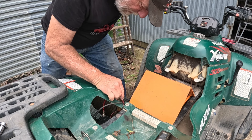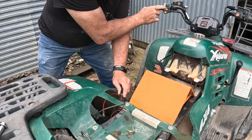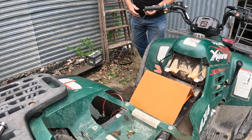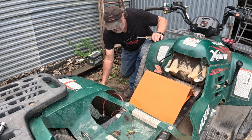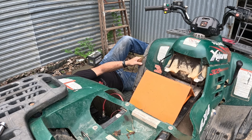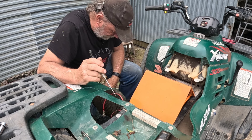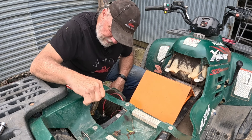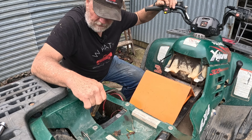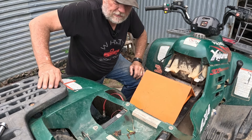I'm going to go to the starter side. My light lights up when we do the positive side of the starter solenoid. I'm going to crawl underneath here and put my alligator clip on the starter — on the stud instead of the wire. Then I'll put my other end on the battery negative and hit the starter button. I am getting power down to the starter. Let's pull that starter off.